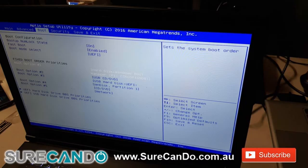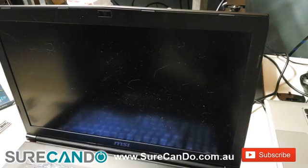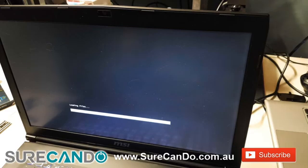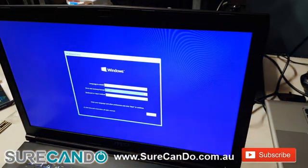So go into boot menu and change the UEFI boot device order and make sure your USB is on the top, and then reboot the system. And now Windows 10 setup should start from the USB. And if your USB is not UEFI enabled, you will not be able to boot like this. You will need to go back to BIOS and change the boot type from UEFI to UEFI CSM or Legacy, one of the two. Here we go, Windows 10 setup.